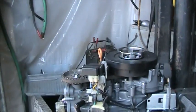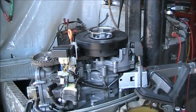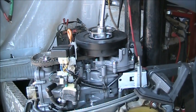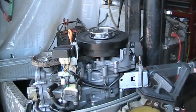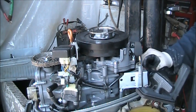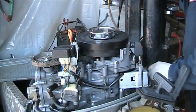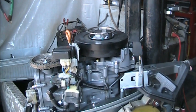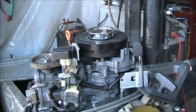So, put you right here. And I'm just going to use this drill, I think, to see what we get. See if we get a poof pop. We got a poof pop. So, most likely we're dealing with a fuel problem. So, we'll have to trace that down. Let me find a fitting gas hose, unhook, get my 4-cycle gas, and we'll go from there. I'll be right back.